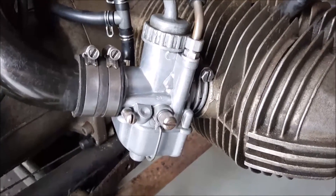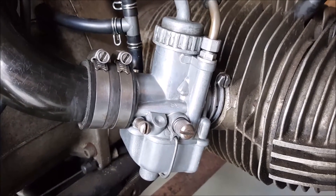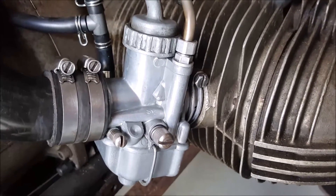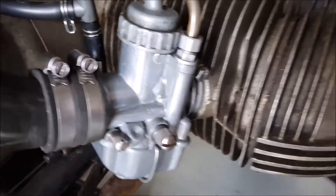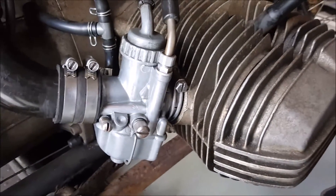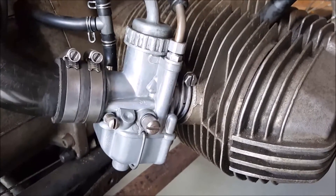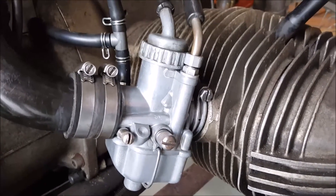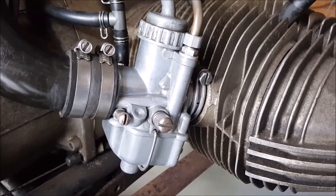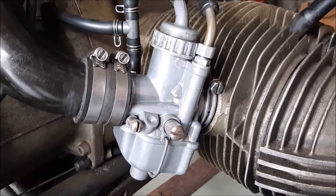A couple of days have passed since the carburettor came out of the cleaning tank. I've given it a polish in addition to the cleaning done in the tank and it's come up pretty nice. One of the main problems it was having was the fuel valve getting stuck and the carb leaking — the cleaning seems to have resolved that problem. A lot of the smaller parts inside the carburettor that I can't access to clean directly have been affected. The ultrasonic cleaning tank certainly didn't bring it up this good on its own — it required some additional cleaning with slight abrasives and polish. But all in all, the ultrasonic cleaning is worthwhile. It certainly gets the inside working a lot better — the throttle was a little sticky before, and that seems to be resolved as well.